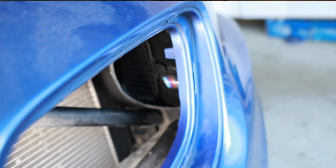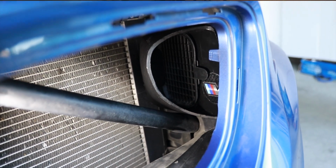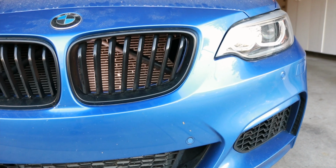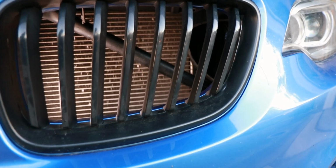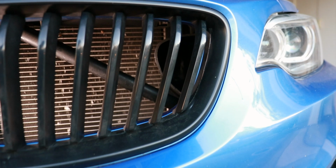In doing so, you've increased the efficiency of your air intake as well as the responsiveness from your throttle. This has to do with the fact that the air scoop actually pushes out the duct to directly behind the driver's side grille, in which it can receive more directional air as opposed to less deflected air because of the bumper blocking the air duct before.